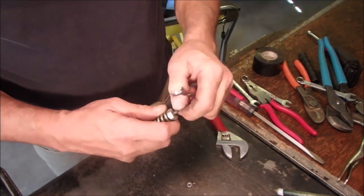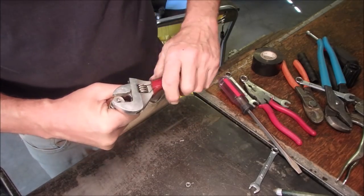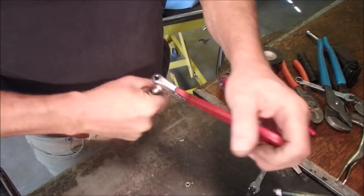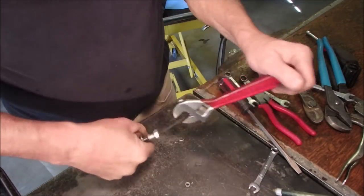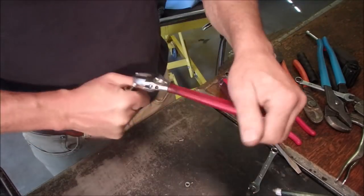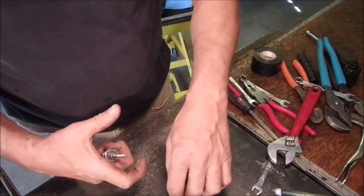Okay, now I am just taking apart this unloader because it's got a bent piece and I don't have spares. I went through my pump parts. I am going to start getting better on pumps. I'm on a mission this year and next. The problem is that they run at 1200 PSI to 2500 PSI or more. And they're made out of soft metal because they're almost an inexpensive commodity.